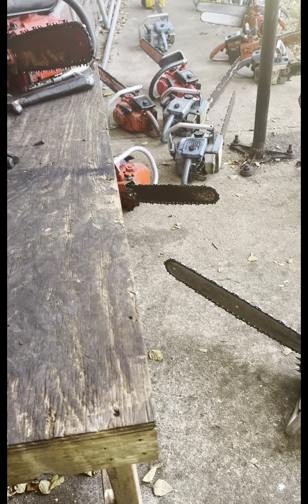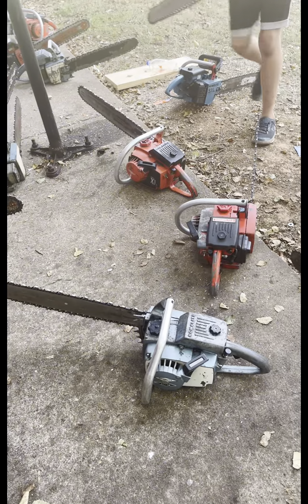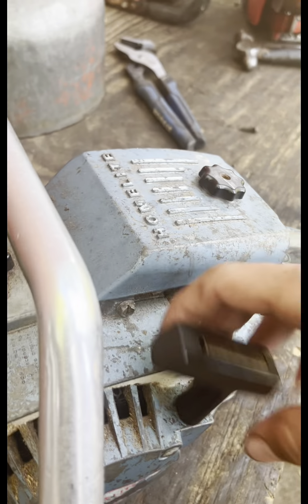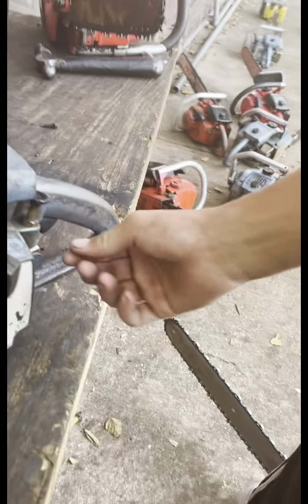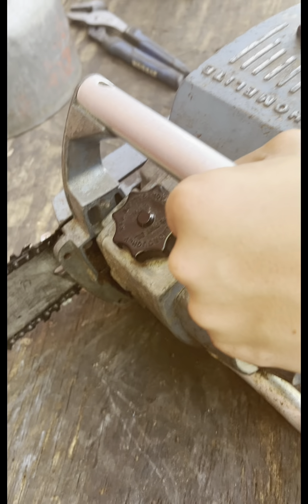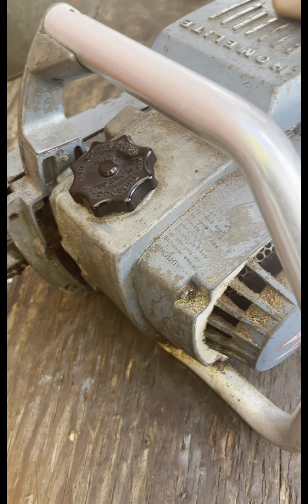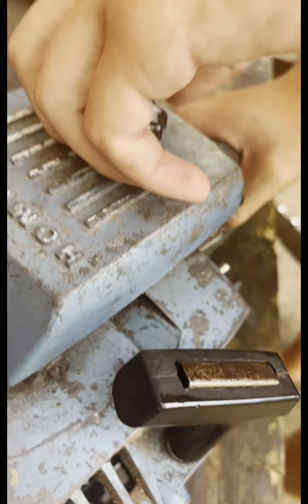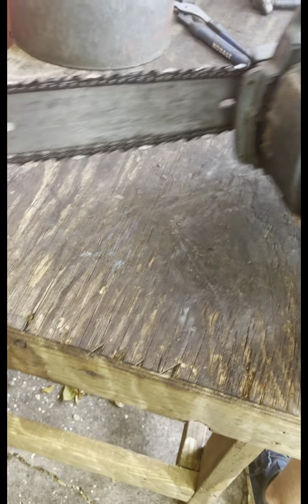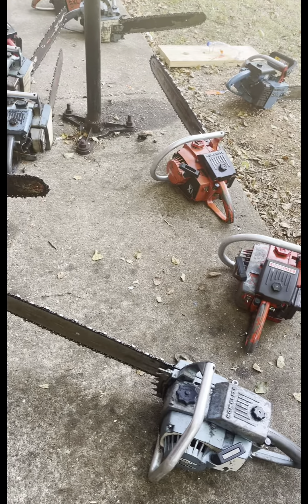XL12 down here, 1968 model. The 1968 XL12 has bumpy knobs on them. The early XL12s just had a little slot for the adjusting screws. There's a different reed block in them — these had a flat reed instead of a cage reed. On the early ones, just metal.